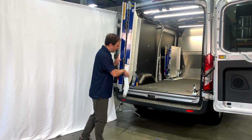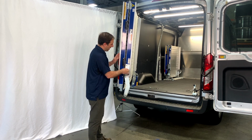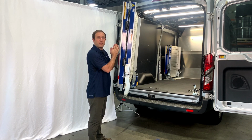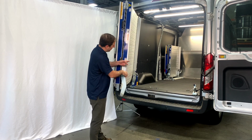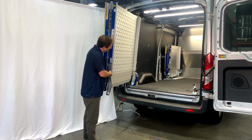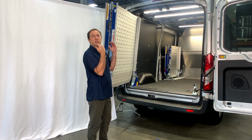So this lock that we were using to release the ramp, the first thing to know about is it actually has a movable finger in the middle of these 2 leaves that grabs the leaves and sucks them together so they're not clapping going down the road. But the second thing it does, if you pay attention to that J-hook over there, is it moves that arm. And that hook is your limit for how far the ramp can travel to the rear.